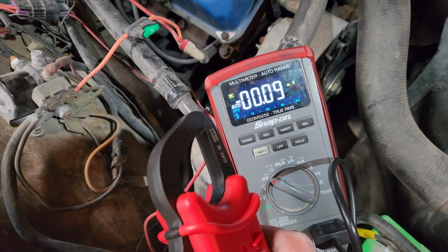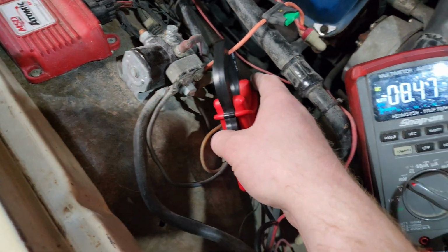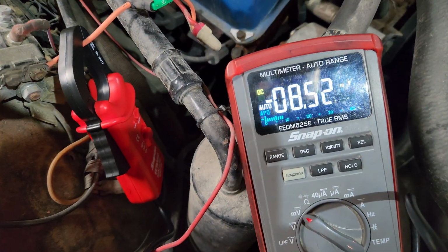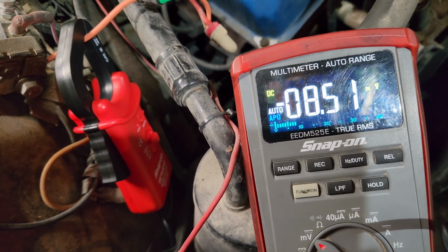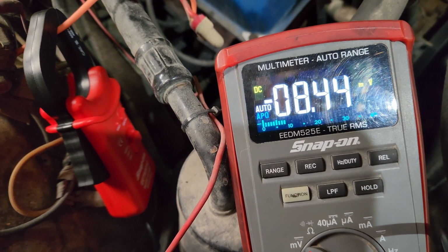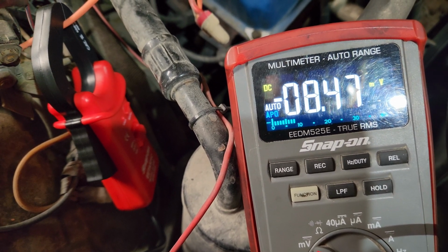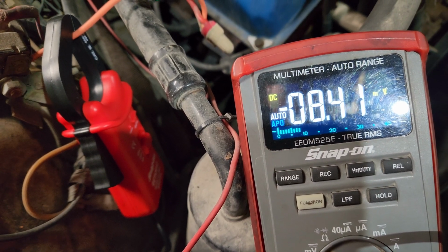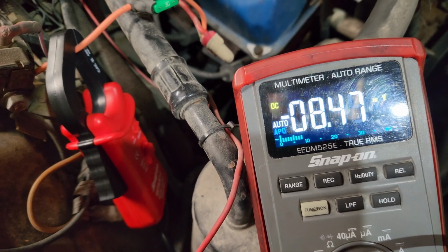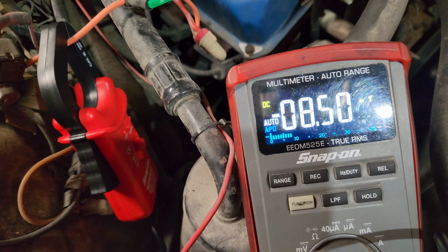Anyway, snap away any extra juice there. Boop. So that blower motor at medium-high setting with a radio at a reasonably high setting with just static is pulling under 9 amps. So that 30 amp fuse is more than capable of running this. So that was purely a corrosion deal. So as sketchy as this is, it's totally safe.